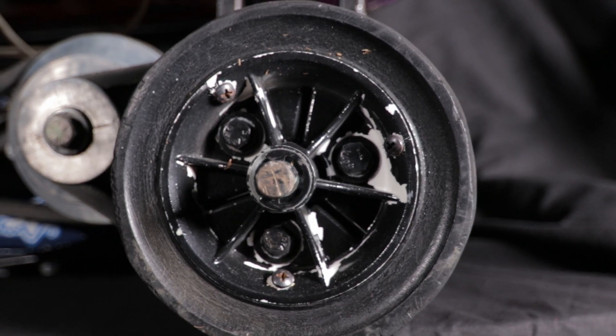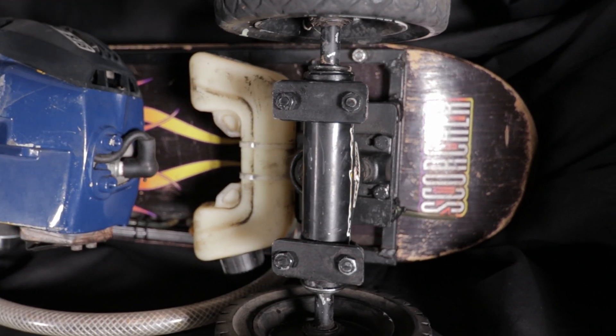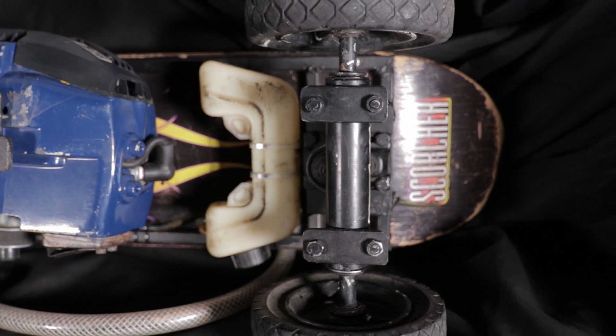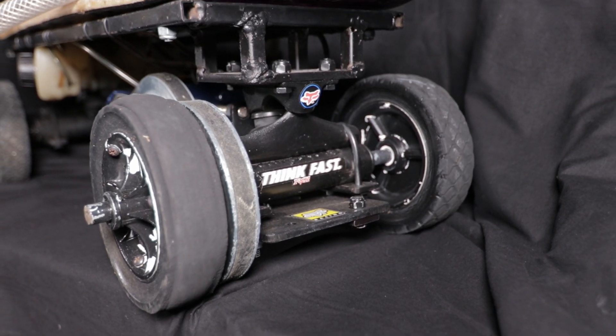I built the extended frame and then I needed tires big enough for a pulley, so I ended up getting these lawn mower wheels. I needed to fit them with an axle somehow, and the hardware store happened to have wheelbarrow bearings. I found some tube that fit the wheelbarrow bearings, then used U-bolts to go around the skateboard trucks and bolt it all together — that also served as a mounting plate that I could bolt the engine to.